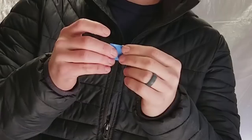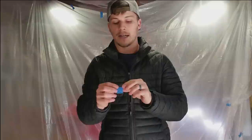and you do this, and then say this is a piece of dirt, I don't know if you can see it. So let's say that's a piece of dirt. You can touch it with the tape and you can lift it out of the clear coat. And if you do it really early, the spot that it leaves, the clear coat will self-level into that spot. It's awesome. It's a really good trick. You can use tweezers too, but tweezers make me nervous because they're sharp and, you know, sharp.